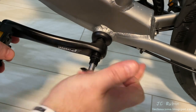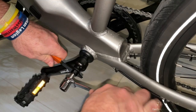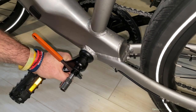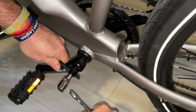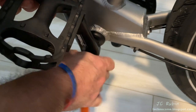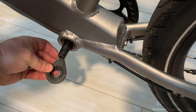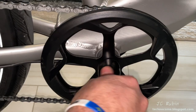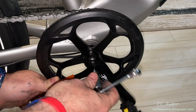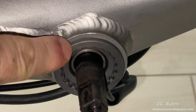I tighten down the slack of the press until it's at full seat and then stop. It's important never to use the crank as support when trying to pull it off — instead use the supplied wrench as support in conjunction with the 16mm. If you hold onto the crank you're working against what you're trying to push out. At some point it presses the crank off. On this side I snap off the cadence sensor to access the lug, then repeat the same process. Both sides are loose.